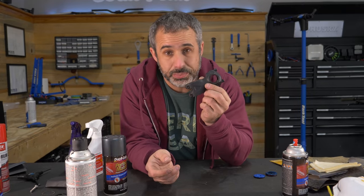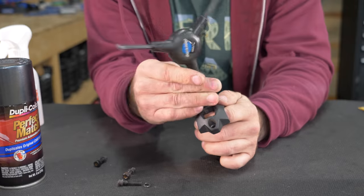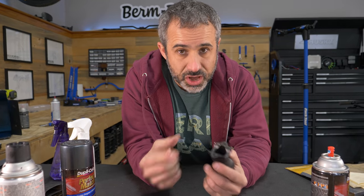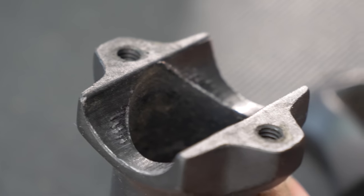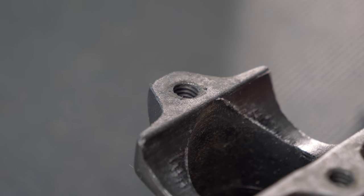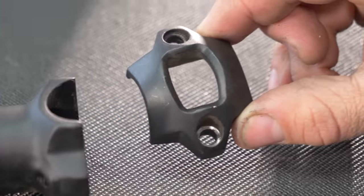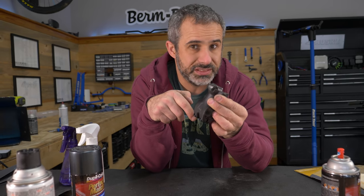This is an inexpensive matte black stem I got off one of the flip bikes — I want to reuse it. It's nice and short and we're going to paint it graphite color, make it really glossy. We're going to take all the bolts out of the stem and paint the cap separately. Paint is actually something that sits on what you're painting, so if we paint the inside it's going to affect how it sits on a handlebar — I'm going to throw tape over it. These holes that screws go into: if you get paint in the threads, especially this paint that dries really hard, it's going to make it very difficult to screw things in. So let's clean it up, sand it down, and mask off all the areas we don't want to paint.